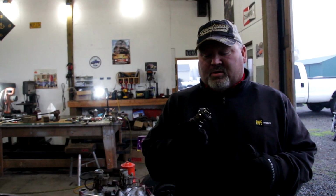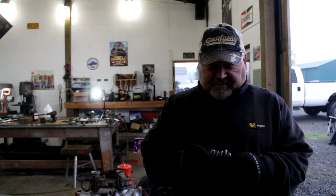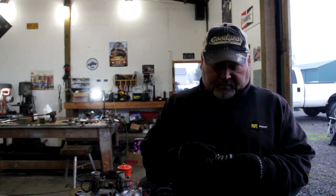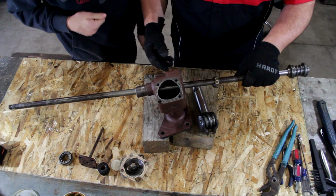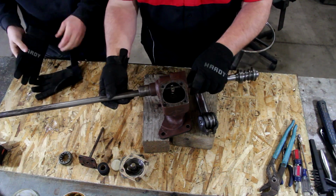Really quick, we didn't show you this earlier, but this is actually the worm gear that's off of the steering shaft itself, and it's in really bad shape. I know that it's worn quite a bit because the gears are starting to get pretty sharp and pointed, and there's a huge pit out of the inside of this gear and a flat spot on here as well. Not quite sure how that one flat spot got like that, but it's definitely affected the steering. That looks fine to me. It's got plenty of grease, and it's gonna be full of gear oil too.